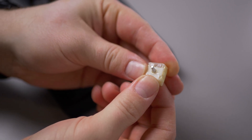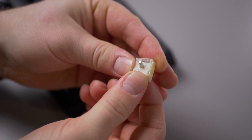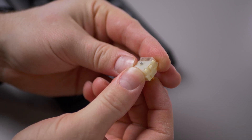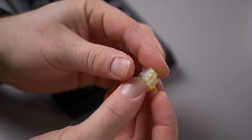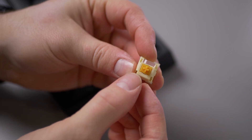If we take a closer look at the switch, we can see it has this metallic spike that is then read by the PCB to provide similar functionality as with Hall Effect switches. So you can set the actuation distance and rapid trigger stuff in the software. The total travel distance of the switches is 3.5 millimeters, which is pretty much the new standard in Hall Effect switches as well.